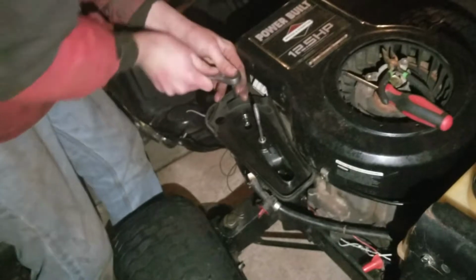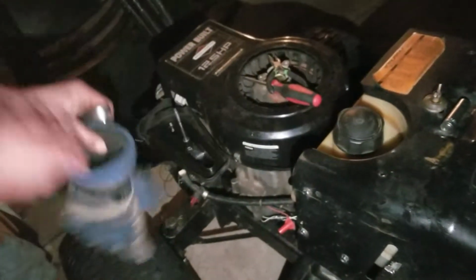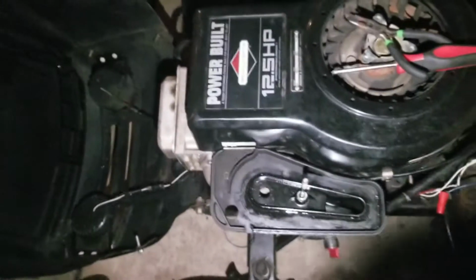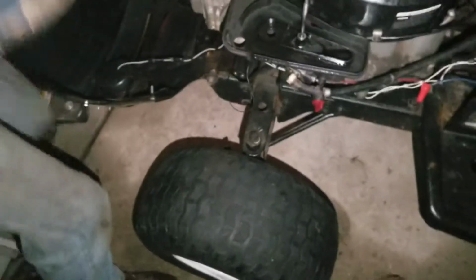That's another thing we'll have to do for this mower eventually, is build a setup for it like mine, because that helped mine a lot with running power. These junk stock air filters that come with these motors really put a lot of drag on the motor, I've noticed. And then the oil system shoots right up into it and clogs the filter up. It's a really poor design. We gotta hook the oil up too. Yeah, that's true. Alright, let's do it.